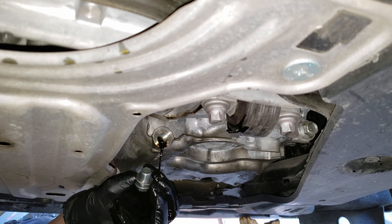Once you get it off, place the filter face down in the drain pan, wait for the oil pour to slow down and/or stop, and wipe the area down with a rag. Now to figure out the correct filter wrench size, first count the flutes — using a label as a starting point. That gives us a count of 14 flutes. Then measure the width of the filter; in my case a measuring tape gives us 2.5 inches, or 63.5 millimeters. So we're looking for a 64 millimeter 14-flute filter wrench. The closest I have is a 65 and a 67 millimeter 14-flute wrench — that's probably why it was slipping a little. A 64 millimeter would have been much better.